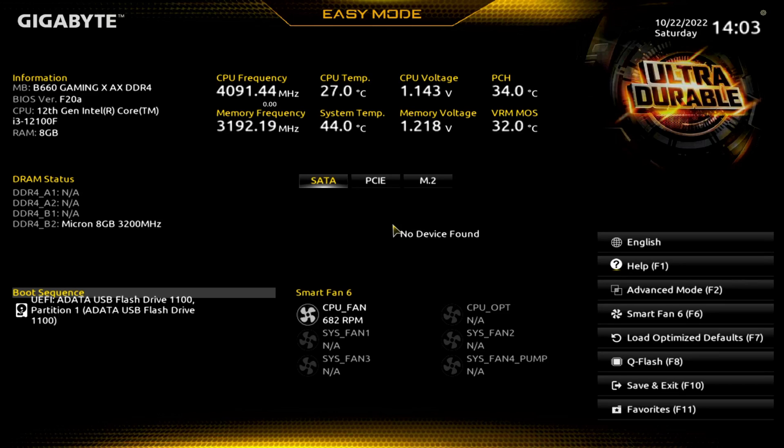I do not have an M.2 installed, but we ended up back in the BIOS. One thing: if you have RAM installed that requires XMP to be overclocked, you may need to do that. The RAM I have in here is fixed at 3200 MHz, so I won't need to. You may also find that if you have a bunch of drives installed, the drive with your operating system may not be set as the boot drive, so you may have to fix that as well. But that's going to do it for this video — thanks for checking it out. Please like, please subscribe. Thank you.